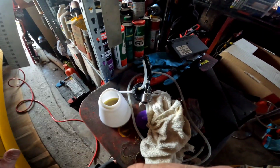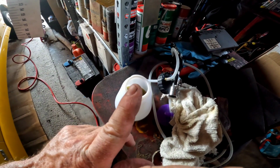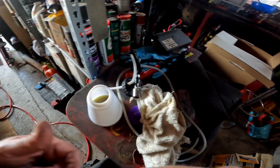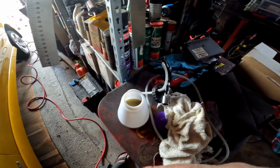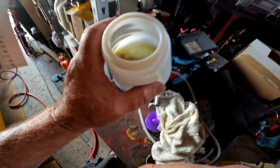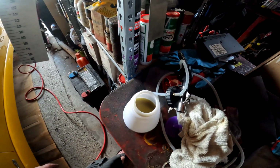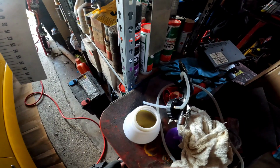But it's one of these things where I don't know if this thing is actually working properly because it's always got air bubbles in it, but it did on the red car too, and it worked. It actually bled the brake. When you're dragging, I thought it should fill up with just solid fluid when there was no air, but it seems to always have bits and pieces of air coming through the hose. So I don't really care as long as it bleeds the brake. I'm going to keep going because that's not great. The stuff I'm putting in is clear, so until I get clear fluid, I'm just going to keep going. Anyway, we'll come back when I've done that, and I'll let you know what happened, eh?